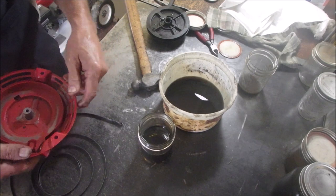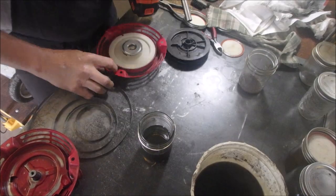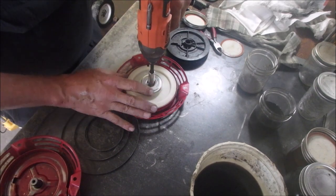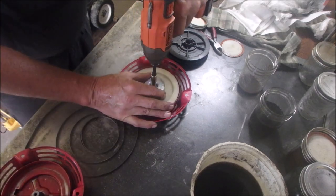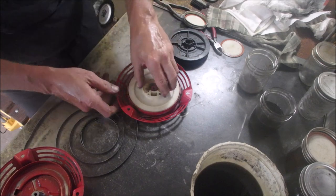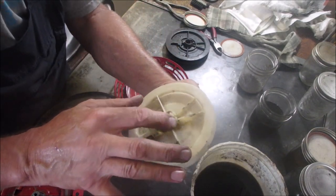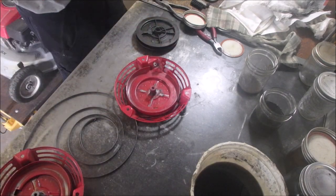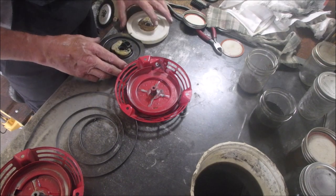So now I'm going to load the spring into the carrier. Alright, let's have a look inside this one — this is an older one, like the one we're working on. These are from the 214-style Hondas and will not fit the newer style GCV160s. This one has no spring, but it has a much nicer, non-deformed plastic piece here. I might use that. See if this is the same — yes! I'm going to use this. That should work.